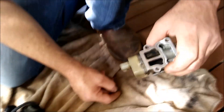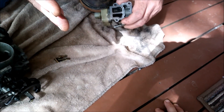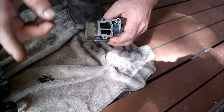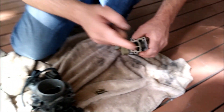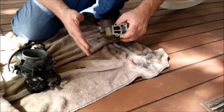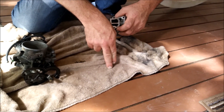When I took it off it already had a gap — you can blow through it. My understanding is that when the car first starts up this thing is supposed to start closed and then open up to give you a high idle. Then as the engine warms up it's supposed to slowly start to close. That is controlled by the PCM, and the PCM takes data from different sensors — mainly the coolant temperature sensor. That is the main feeding mechanism to the ECM.